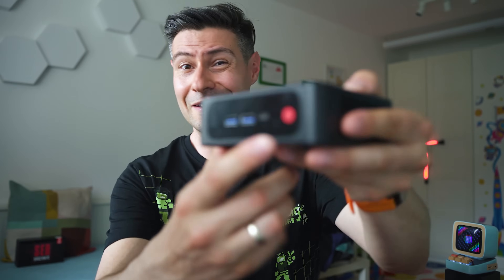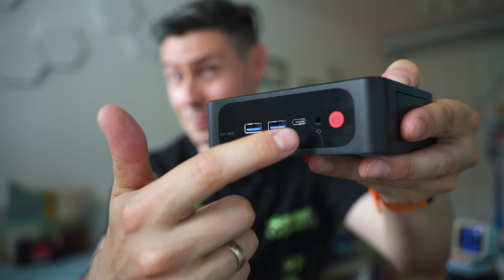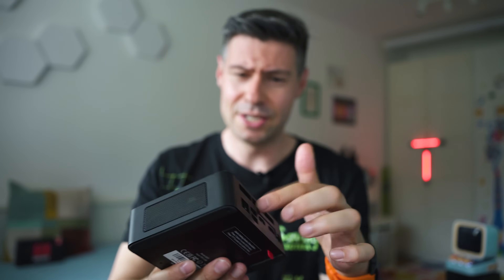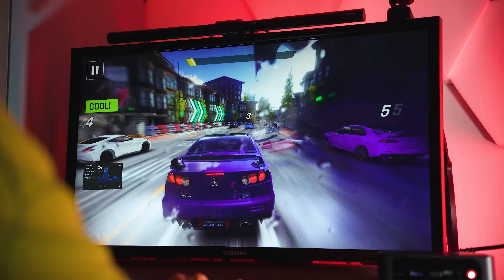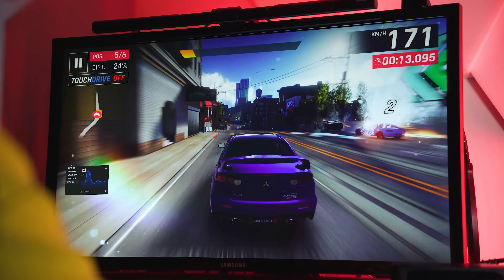The more significant drawback is this port on the front. In some other mini PCs which are Intel-based, that would be a Thunderbolt connection — but here it isn't. It's just a Type-C connector. So this mini PC does not support adding external GPUs. If you're a gamer, be warned that you can only count on the integrated graphics inside the CPU, which is not too bad given the tests I've performed.